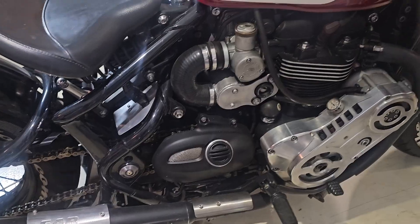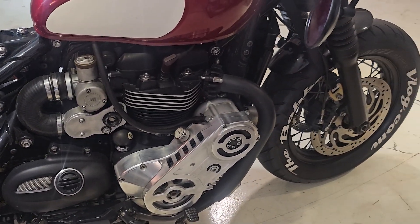This bike is around 70 horsepower standard and these are apparently good for 100 horsepower. At the moment this is between 120 and 140 horsepower depending on how I've got it tuned with the TTS and Rotrex supercharger on it. So I know the motor can produce the power with boost. But what sort of power am I going to get with this turbo? And maybe if this guy works, have both of them — but that's another story for the future.